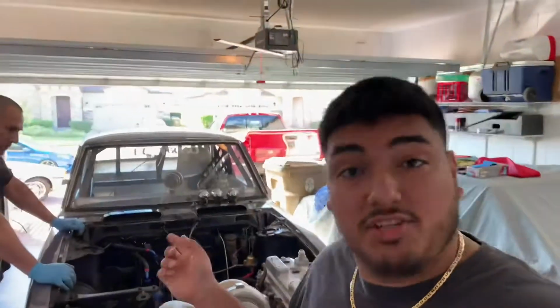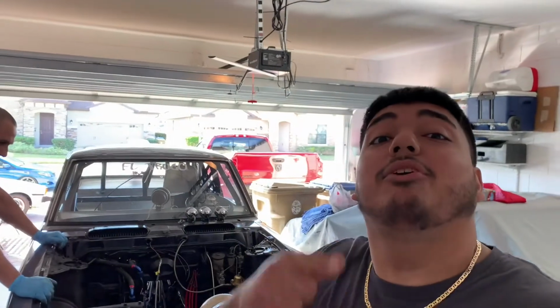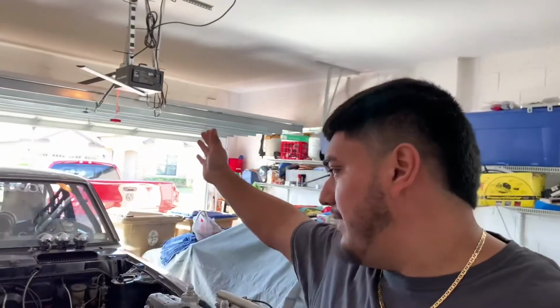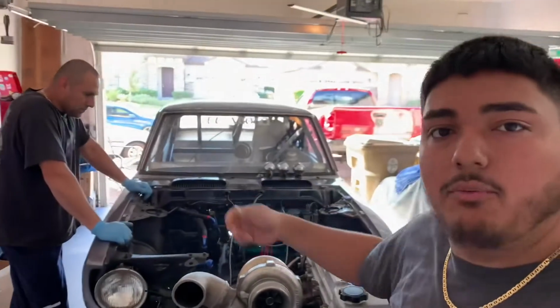He had taken this motor out before, when the transmission broke. We didn't know that, so we tried to take the transmission out and leave the motor in. We didn't know it was a lot easier and a lot faster to take the motor out, with the mounts and wire harness and everything. The motor comes out perfectly. It has enough space to come forward and disconnect from the transmission. Then the transmission is just hanging there, and we can take it out just like that. So that's a lot easier.